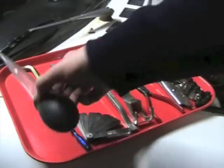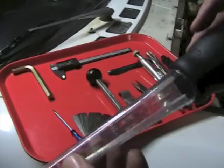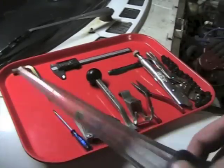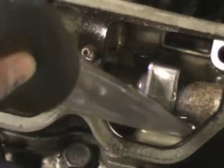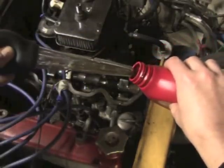The second thing may seem a little odd, but this is a gravy baster. It's a plastic one — they only cost about two dollars. Don't get a glass one, and don't use the one out of the kitchen, and don't ever put this back into use for food service. You're going to use that to drain some of the oil out of the top of the engine and transfer it to a clean container, because when we're done you're going to want some of that oil back to baste the cam lobes and the shims and bucket tappets.